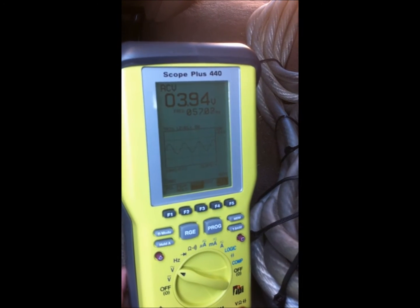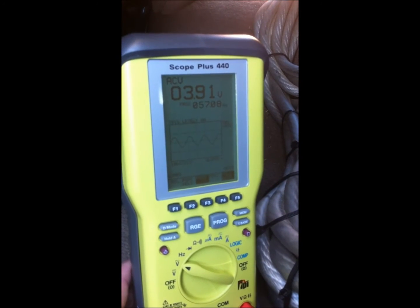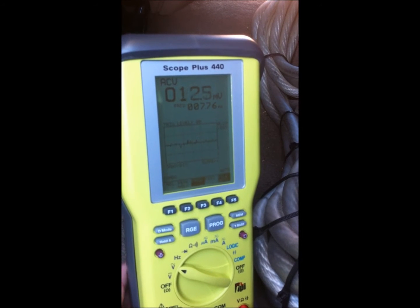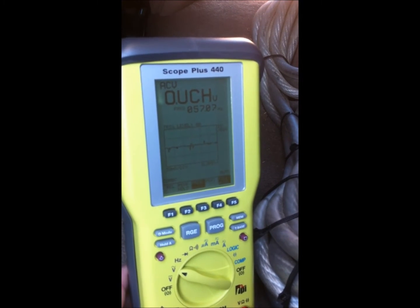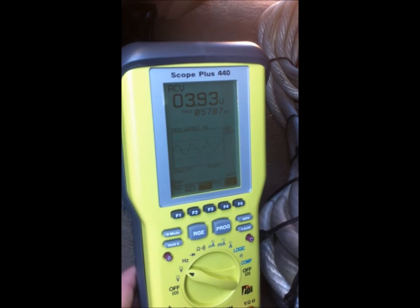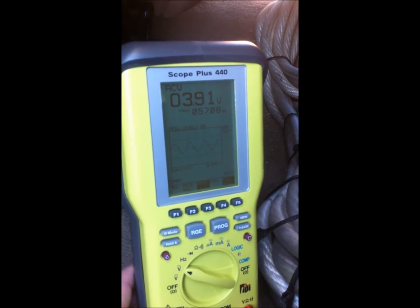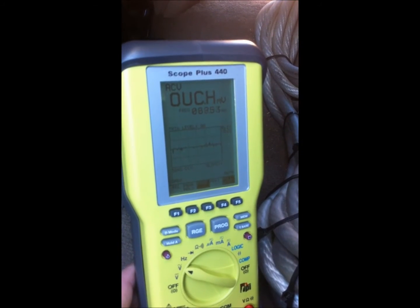I've got it sweeping my peak frequency that I play at and the volume level that I play at, and I have no clipping. That's at my 57 Hz tone. You can see my deck pre-out voltage is right at about 3.9, right under 4 volts, which is pretty good — that's right where we need to be. So our deck isn't clipping and everything looks good as far as that goes.